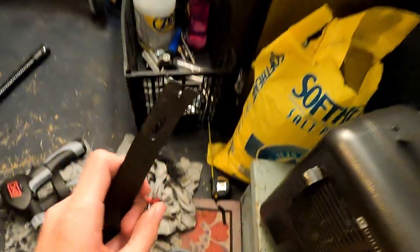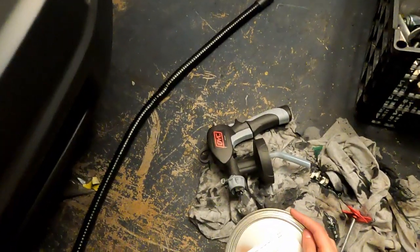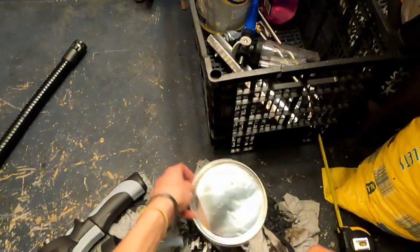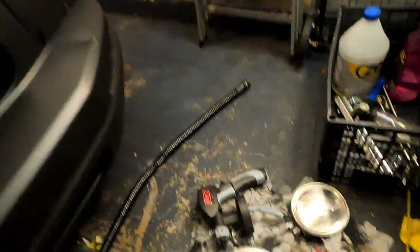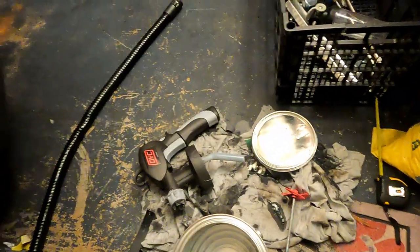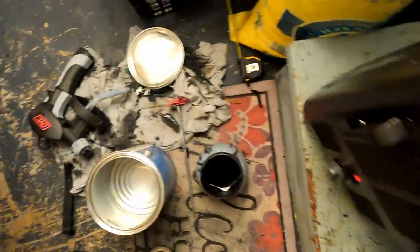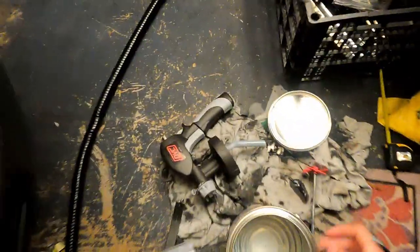So how the pearls work is that they're these little flakes almost, or flakes is a different thing. But it's this little, almost like glitter-like powder that you mix in with the clear gloss top coat. That's what you want to use for the pearls. So I got 2 gallons of the clear gloss top coat. Usually, you want around 25 to 50 grams of pearls per gallon of top coat. 50 if you want the color to really stand out, and 25 if you want a less flashy, I guess, appearance. In my case, I decided to go 25 for 2 gallons, so 50 grams in total.